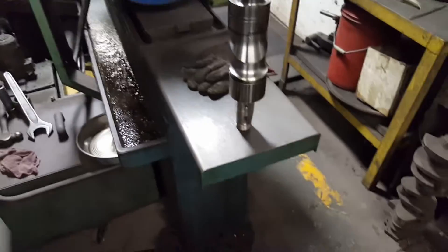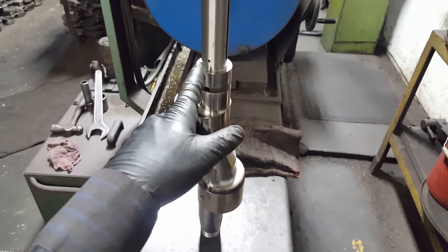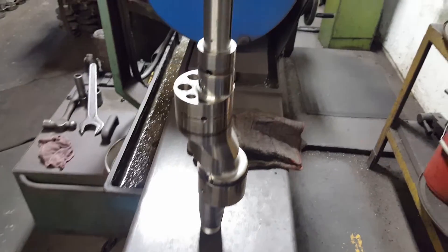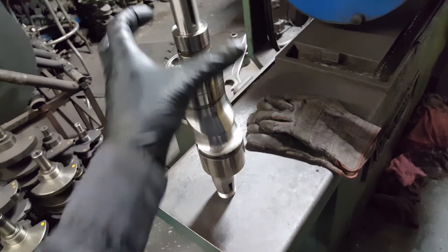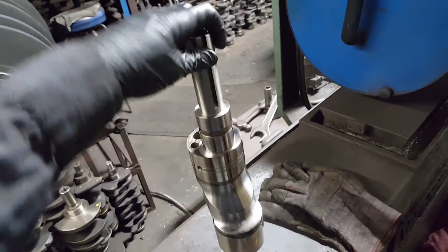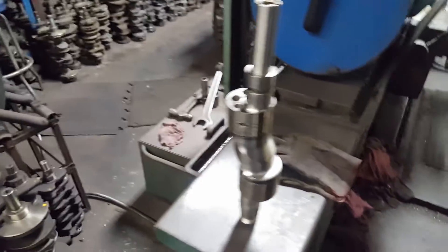So the rotors are clean, the e-shaft is clean and polished. All I have to do now is inspect the needle bearings, the chains, the counterweight. Every time you guys purchase an e-shaft, make sure you buy the full assembly — including the little nut on the bottom, the little key, the needle bearings, the flat washer, the huge washer — the huge washer goes on top of the stationary gear — and the main bolt. The full assembly, so you can make sure everything is balanced. But yeah, that's what it is. That's the update on the recycle project. Thanks for watching.